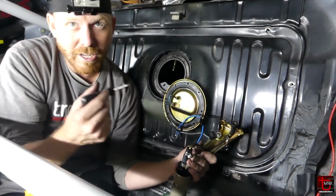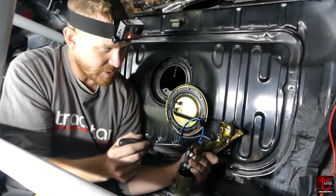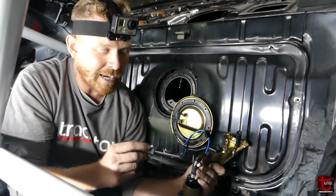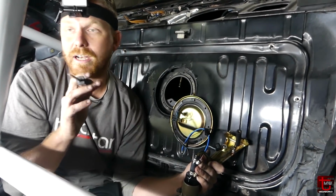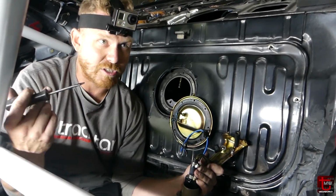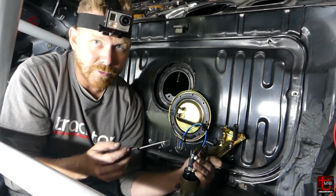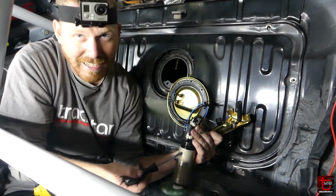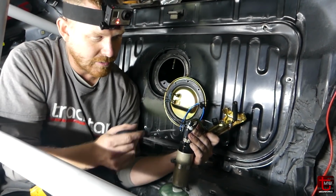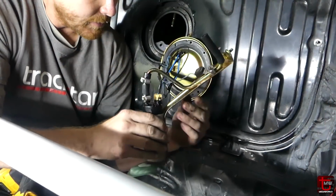I cannot stress enough how important these junctions are. They must be fully tight. When we first started, we got 90 PSI, and then as it loosened up, I couldn't get more than 45 PSI. No coincidence that anywhere above 45 PSI fuel pressure, we were having breakup. This is the only part of the fuel setup that I did not touch, and now it is the problem. You cannot pay too much attention to fuel setup.